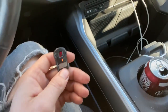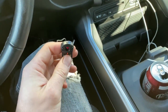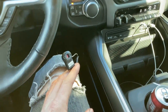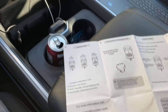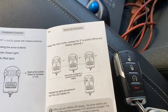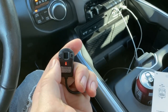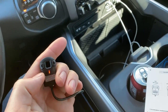Race mode level nine is probably your most aggressive, but I don't know if I want to drive around with that all the time — you tap the pedal and the thing takes off like a rocket, which could be a little unsafe around town. But the stock throttle response is just awful. Holding the Sprint Booster button for three seconds shuts off the display if you don't want that number showing, and whatever mode it was in gets locked in.